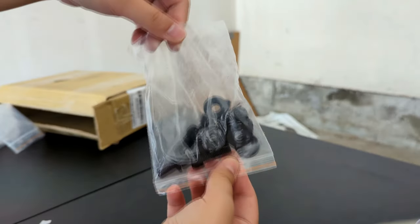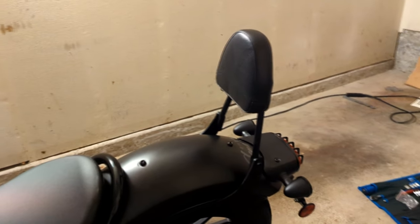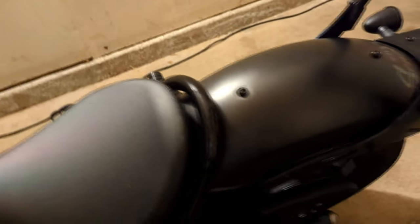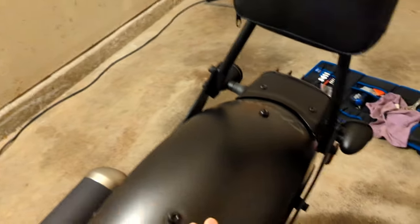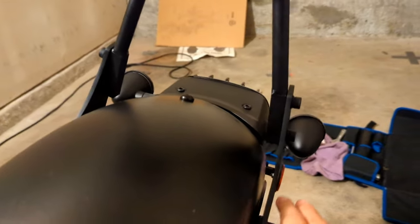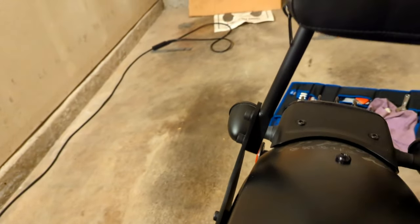The package also came with its designated hardware, and I'll be explaining which ones to use and how to use them. This is what the sissy bar looked like when installed — it was a very straightforward and easy installation, just takes a bit of time, patience, and some elbow grease. You make sure you have the right brackets for each side; they curve inwards so you can tell which side is which. Then you take the spacer, put it between your fender and the bracket, and take the longer screws to attach the bracket to your fender. Then you take the shorter screws and attach the sissy bar to the bracket.